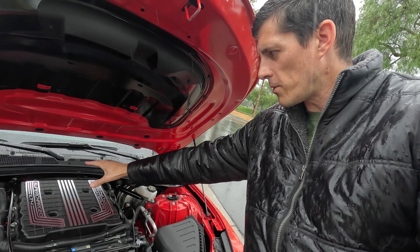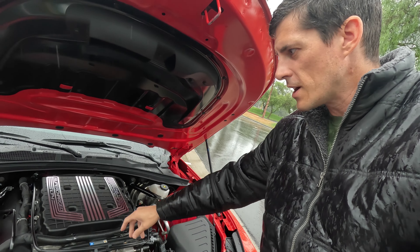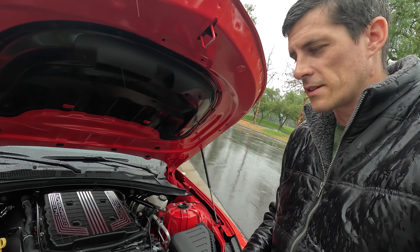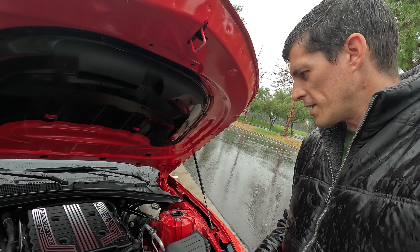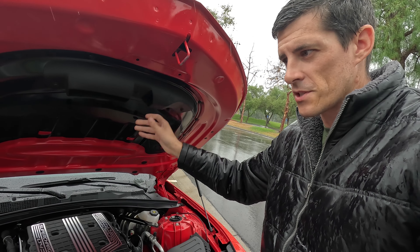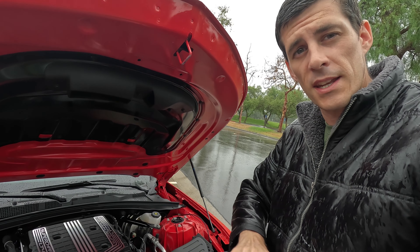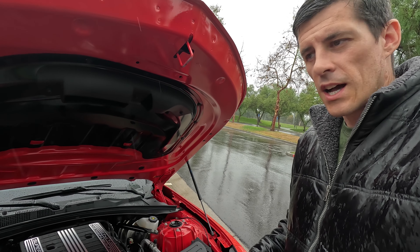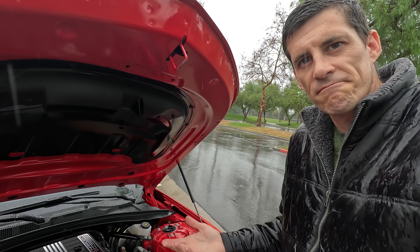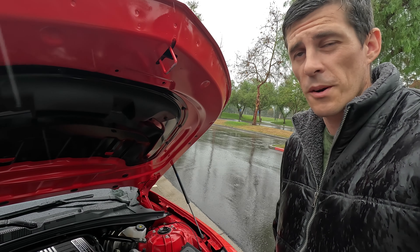This leads the water that drains down into it away from the engine, so you don't get water all over your beautiful supercharger. It doesn't get on the injectors and it's not going to cause you any problems. GM says without this during heavy rain, it could cause damage to the engine. I know people that have run it without and not had problems, but you're kind of gambling. Just put it back on, especially if it's raining before you're done so you don't get caught in a storm.